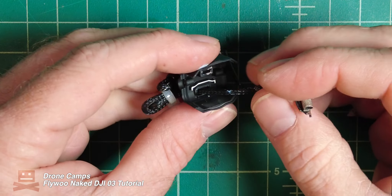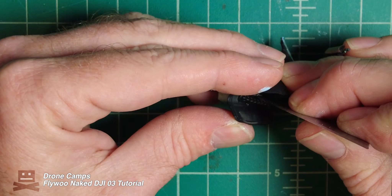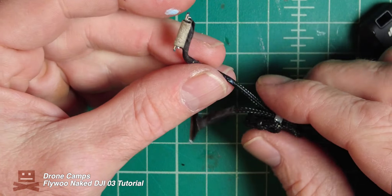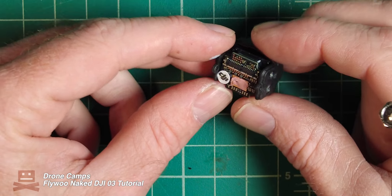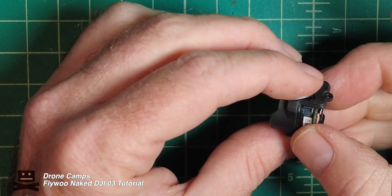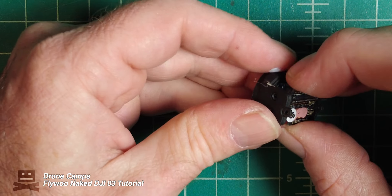Now I have that glue off — it only takes a couple of seconds to really loosen it up. We should be able to remove this outer piece of plastic if it's in the way to get the harness through. I didn't want to destroy this camera housing because I may put it back in there later — it fits just through that hole. Now you have your camera cable out of the camera housing and you're ready to remove the camera housing itself. There are four M1 screws here to remove. This is a super sturdy plastic shroud around this camera, so don't be surprised if it takes a little bit of wiggling to get it out.